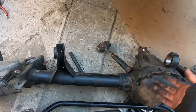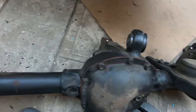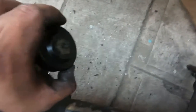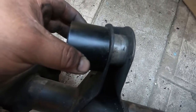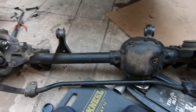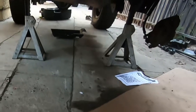After we install them we'll tell you how we did it. Both of the new bushings are in — one went in real easy, the other was a little more of a struggle because getting the impact on there was difficult. All we did was use the cap from the ball joint removal tool, which fit right over the lip, and on the other side we used a seat piece and drove it in with the impact. Now that these are in we can go over to the body and cut those mounts.